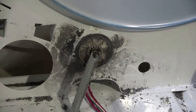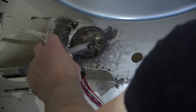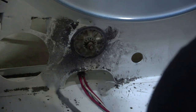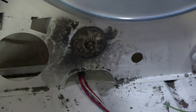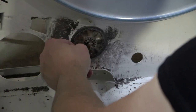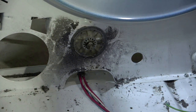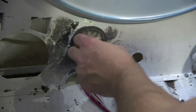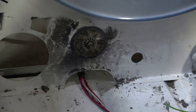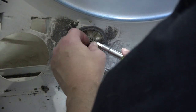We've got this bracket down here on the bottom of this pulley we need to remove. This should just wiggle off — there's a little clip. I think the new kit provides this little clip though. This one is just full of hair and debris; it's no wonder there was a problem. There are a couple of little triangular clips on each of these — one here and one on the other one as well. I've got to remove those triangular clips and I'm just going to do that with a little flathead screwdriver, prying it off.